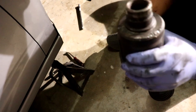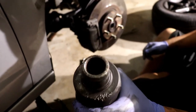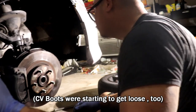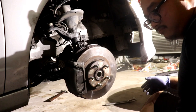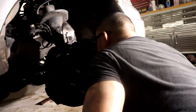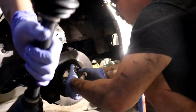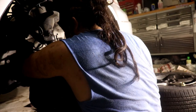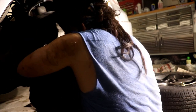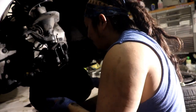There's a lot of corrosion in that old CV axle. That thing definitely needed to be cleaned out or changed out because it was bad. We're going to clean out the spline since there are remnants of corrosion in there too, wipe it down before putting on the new axle. Be sure to put axle grease on both ends — only on the splines, not the threads.